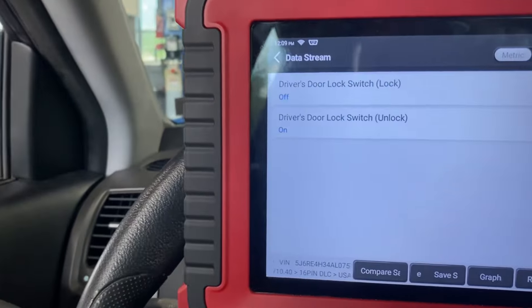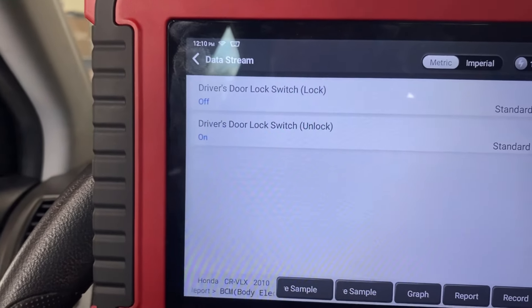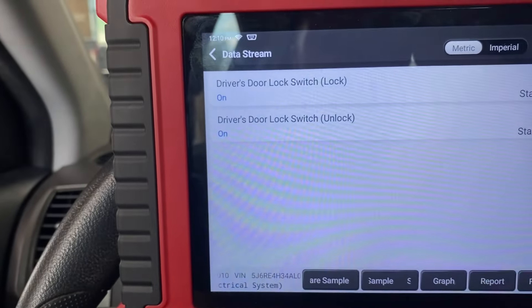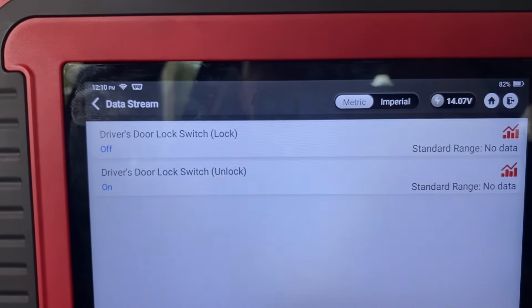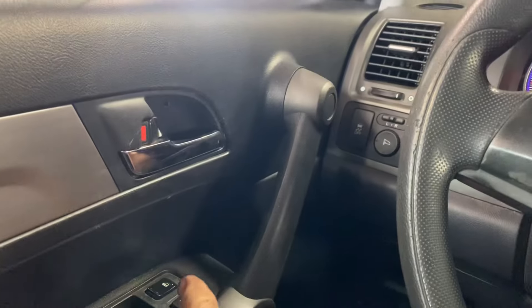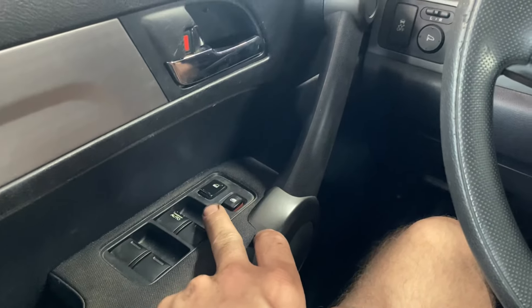It's saying that we're trying to unlock the door, so the lock side is not changing state. Once the vehicle starts driving it starts going crazy because after it hits a certain threshold — like 10 miles an hour or whatever it might be — it's going to try to lock the door. When we push the lock button it changes state to on, so it's getting that input. However, it's saying the driver is always pushing this button. Something's going on — we've got to narrow down why it's always commanding unlock. Our issue might be in that mechanism itself or a control module of sorts, so we're going to dig into this door panel and find out.